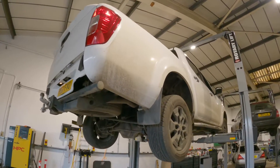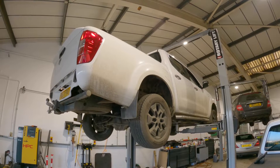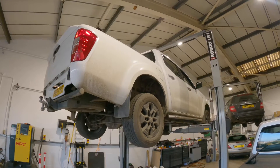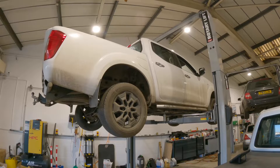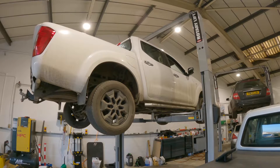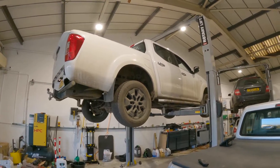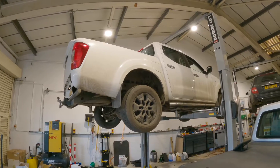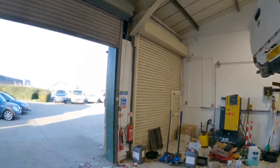I hope you found this short video useful. We've got a 2017 Nissan Navara NP300 with the engine management light on and no fault codes if you go in through Nissan — but if you go into the EOBD, the fault code is in there. The fault was for the knock sensor, and we determined which one it was by putting it on the ramp, unplugging each sensor separately, and confirming with the live data. This one just needs one sensor — they're about £400, so you want to make sure you order the right one. Both are the same price but different part numbers; the rear one's cable is probably slightly longer. Hope you found it useful — see you on the next one.